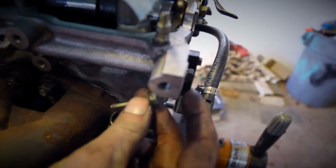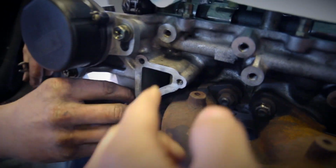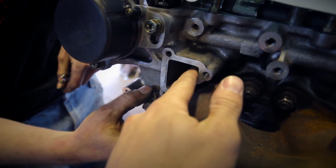In this clip, those 2 bolts that he's holding in his hand, we're trying to say that we forgot to put those in, and we're also trying to warn you guys to not forget to put these in. They're easily overlooked. They're just 2 head bolts. One goes in the back and one goes in the front. They're on the exhaust side of the head, so don't forget to put those in.